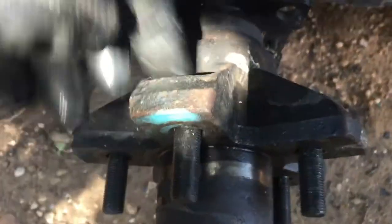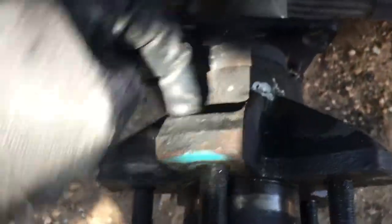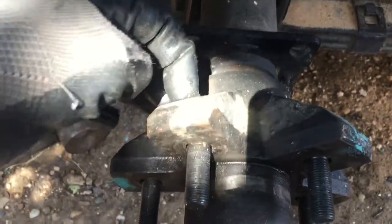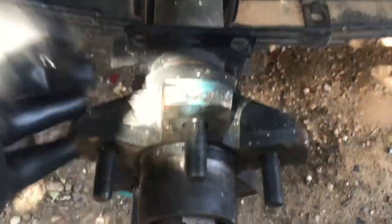I've got them all on there. Quick tip: if you don't know how far to drive these studs, just look back there till they're flush — pretty tight and touching the back of the hub. A good thing to do is, before you take the old ones out, look and see how the old ones look — see how far in they are — and when you put the new ones in, just try to match that depth. Then go ahead and take off that spare.